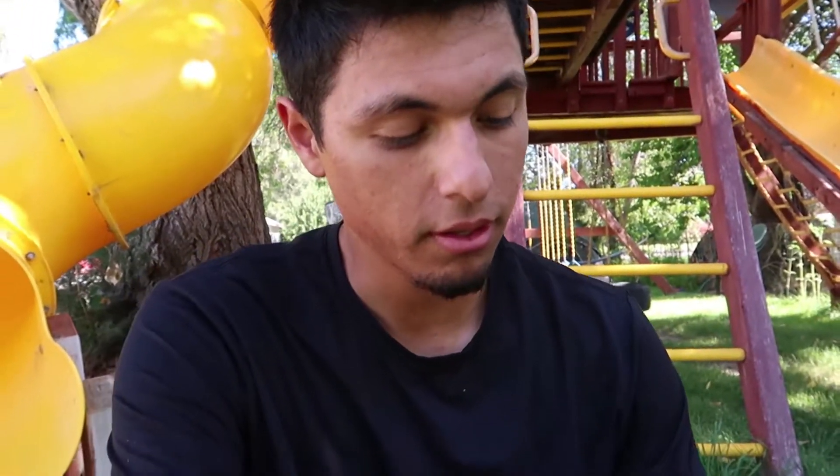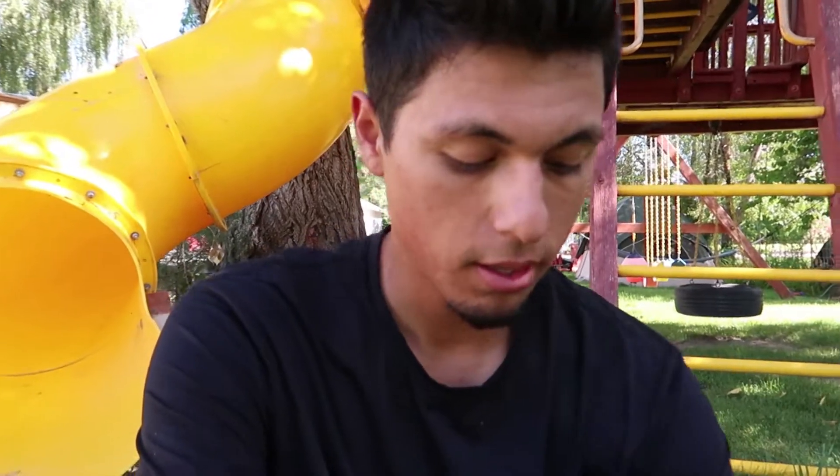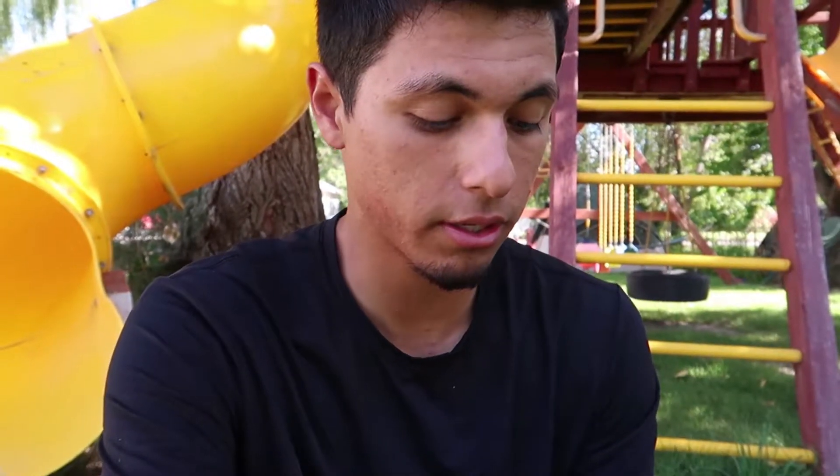Okay, so this is what we're doing. We're hitting it with 400 grit first — just going around the bumper because it has some bugs and dirt all over it. Then we'll hit it with 600 grit after. That should be enough grit to catch the primer. After we prime it I'm going to sand it down again to smooth out all the imperfections, then we'll go ahead and paint. I still have to pull everything off, so I should probably do that first.